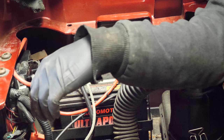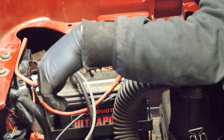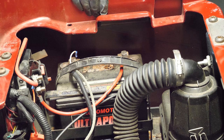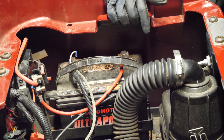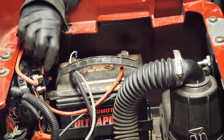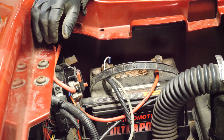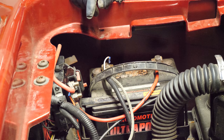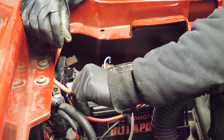So technically right now the cart is connected. Disconnected. Connected. Now if I keep it disconnected, I'll turn the lights on and they don't work. I flick the breaker — the lights do turn on. Turn the breaker off — lights off. Turn the cart on. Nothing from the solenoid. I am going to straighten these wires out so they're not touching the exhaust. See how it runs. And if I disconnect it, we get nothing. That is basically how to install a breaker or a kill switch on your cart.